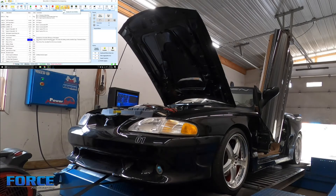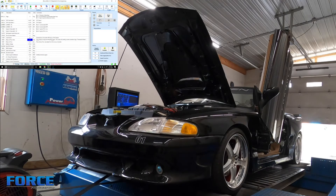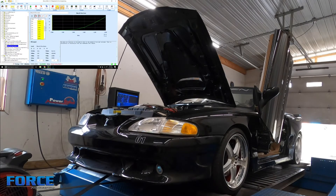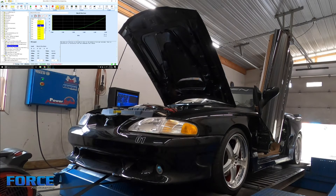This is a screen recording from my laptop - it's kind of hard to see in the little screen in the corner. What I'm doing here is steady state: I've got the dyno locked at a set mile-per-hour. The highlighted cell in blue on the tuning software is the mass air voltage. I'm regulating throttle position to move the mass air voltage up and down, logging the point on the mass air transfer where voltage matches airflow, and referencing the wideband reading in the seat next to me to make corrections.